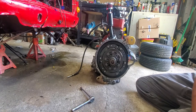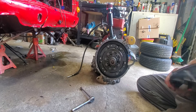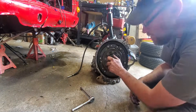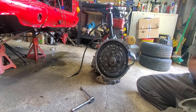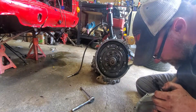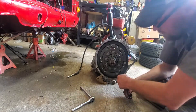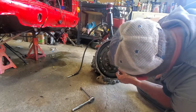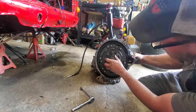Okay, there's the cover off. Now what you see me doing here is inspecting the cover to see if there's grease in there, and there actually was. Now there's a little sleeve right there that the throwout bearing rides on - that sleeve needs to pop off. You'll see me here in just a second popping it off.